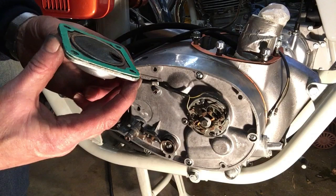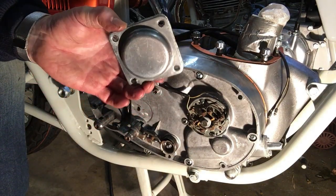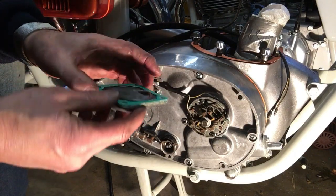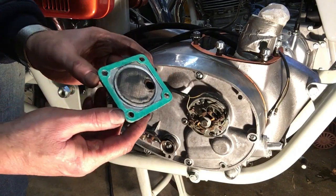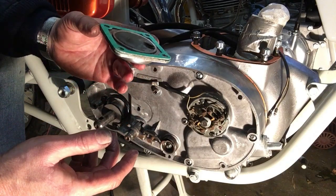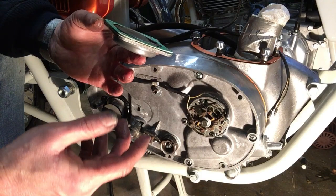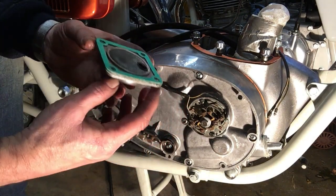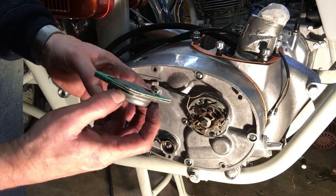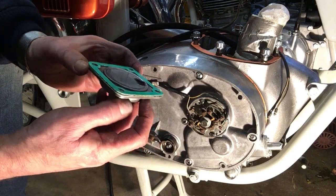Next little job is fit the sump plate and the sump gauze. So the sump plate cleaned up really well. This is metal and plated. The gauze filter that you saw earlier has cleaned up really nicely. So all I've done initially is assemble the gauze filter on the plate in between its two gaskets, and a light smear of silicon sealer on all surfaces, building that sandwich up.